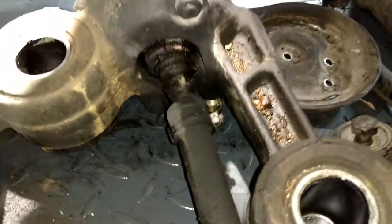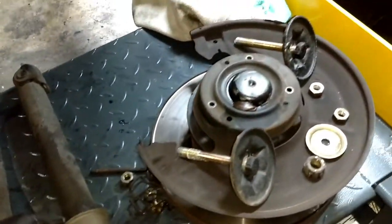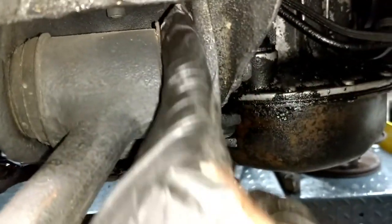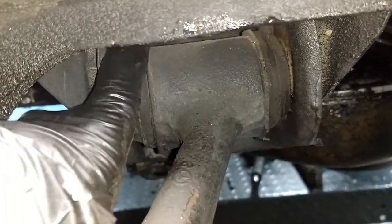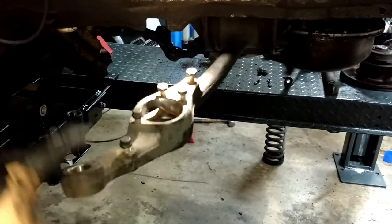I'm going to leave that alone and clean it up. You can see we have the brake control rod bushing housing removed, the brake control rod, the spring mounting perch, the front connecting bushings — I'll replace those — the spindle, the shock, the bolts for the brake control rod housing, the dust shield, and the rotors and bearings. And there's all the front steering linkage — I've inspected this, and these bushings are in outstanding condition. They still have the little tabs from the factory, like a new tire with the little prongs that stick out. Very good condition — there's no flex, no play in that.